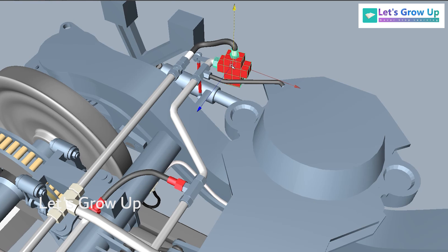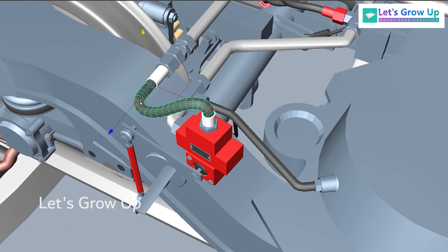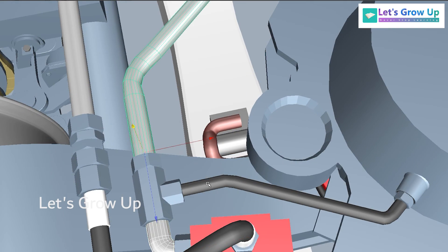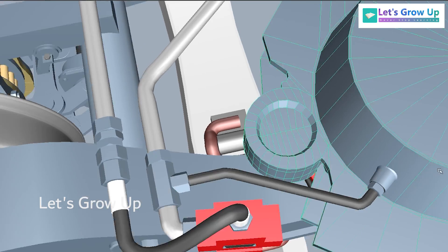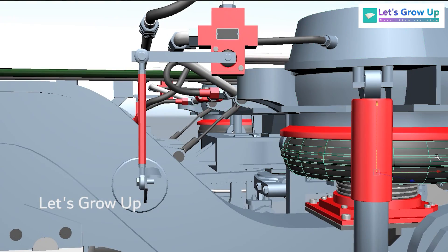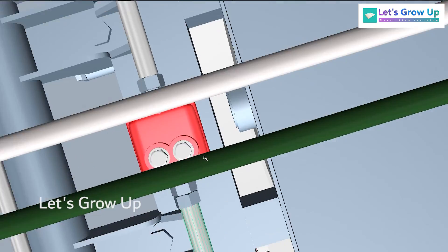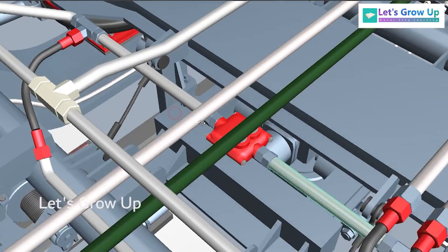This is a flexible pipe, and here is a valve called the leveling valve. On the other side, there is the same arrangement: flexible pipe and leveling valve. From the leveling valve, the output pipe is the sub pipe, which by the T-joint enters the air bag. In the middle of this pipe there is a small device called the duplex check valve.